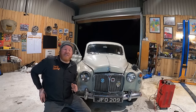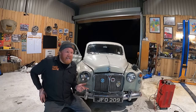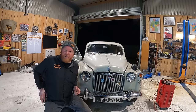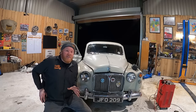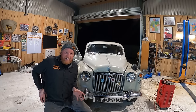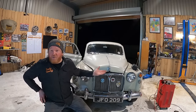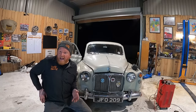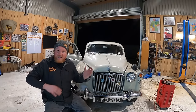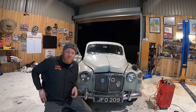Next. It's not charging. Sometimes it does, sometimes it doesn't. It might burst up to sort of the highest I've seen, it's like 12.8 volts that's going into the battery. I think it's the alternator. The alternator's probably knackered. Problem is it's not from this car, so I don't know what alternator this is. I might have another one, will it fit? I'm going to have to grind holes in it and stuff again, same as I did with this one. Problem.